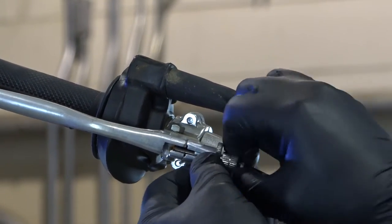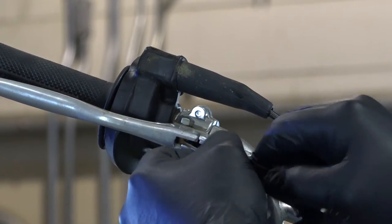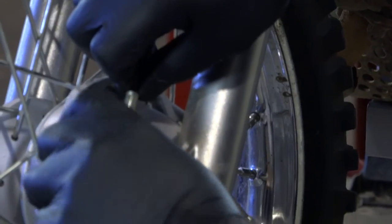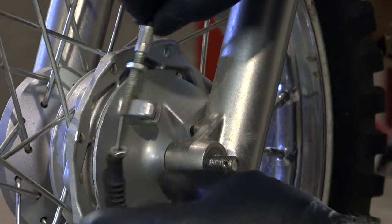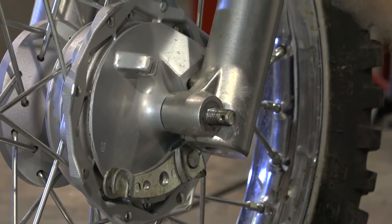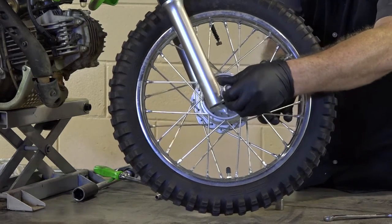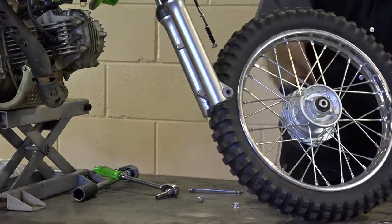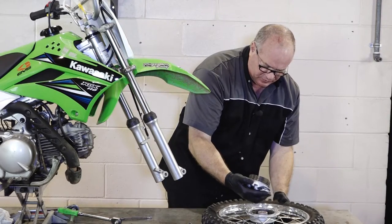To give us some more play, take off this upper cable clamp and bring the adjuster all the way in. What we're trying to accomplish is getting the cable actually off of the hub. Plus, if yours are worn out, all this has to be readjusted anyway. Now go ahead and run that lower bolt all the way off, bring it up, and then it just slides out of that channel. Swing it around and lay it out of the way. With that disconnected, we can go ahead and push our axle through and drop that front wheel out — make sure you don't lose the spacer — and then it just lifts straight out.